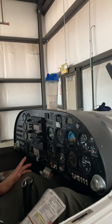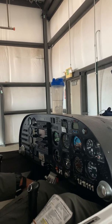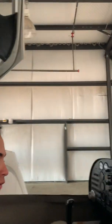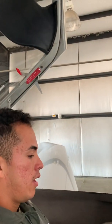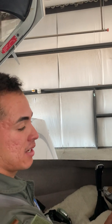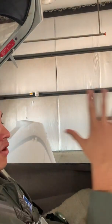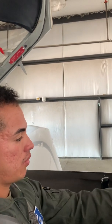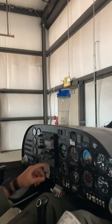At the end of 10 seconds you're gonna come down, put the throttle to idle, move it up about a quarter inch to an inch, and turn off the fuel prime. From there we're gonna identify the closest fire extinguisher — fire bottle, prop clear. Then you're gonna start the engine: turn and push. Turn it for a maximum of 10 seconds until the engine starts, then remove your hand. Adjust the throttle as needed to achieve 1,000 RPMs on your tachometer.